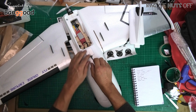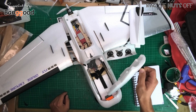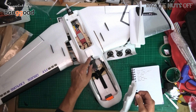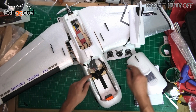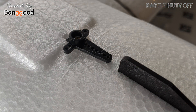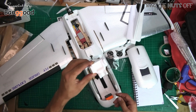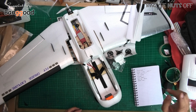There are a couple of things you need to be aware of. First is the camera mount - you'll notice I've used a servo control horn to keep the lid down because I wasn't particularly impressed with the magnets. Using the hole for the GPS puck, which is in the wrong place at the front when it should be at the back, and the antenna tube they included, I made a little latch mechanism for the lid. It does come with this extra piece of foam, and there's currently a Runcam 3S in the nose - the model would also support a Runcam 2S.